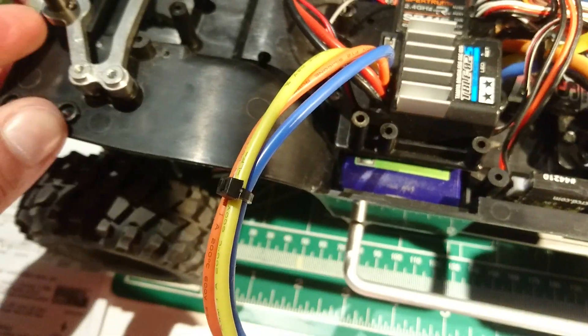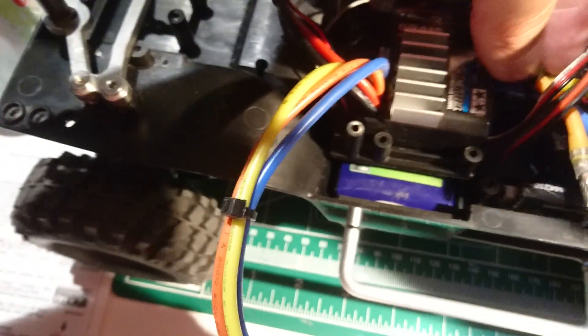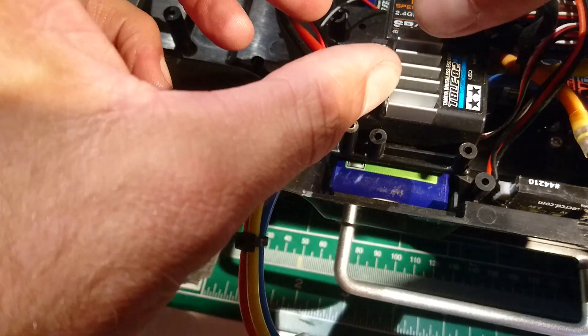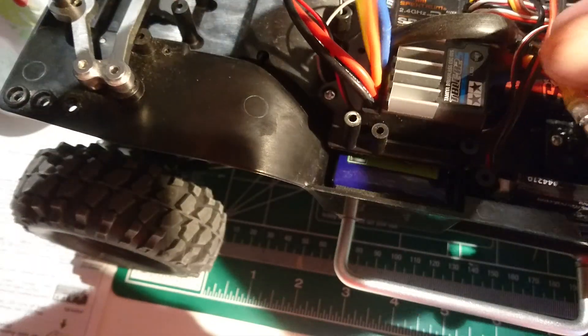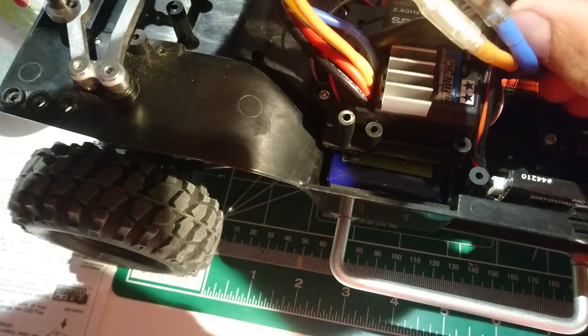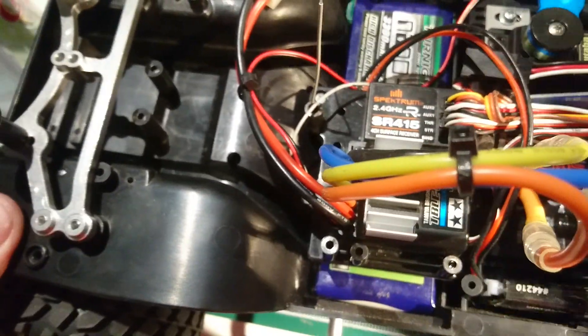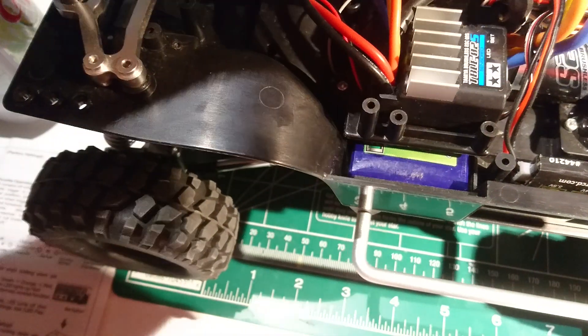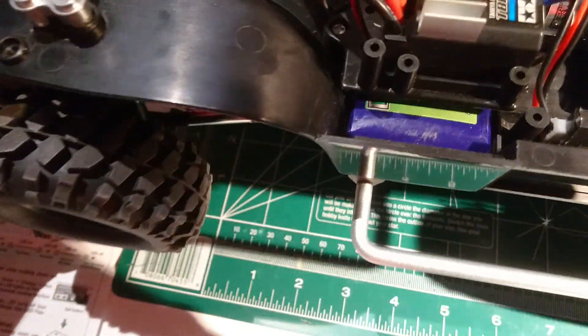Except now I don't have a motor hooked up, so I'll turn it off. I'll go ahead and plug my sensor wire back in — which will probably take me a second. Sensor motor's plugged back in. I'm going to hook up the brushless wires. So now I have the three brushless wires and the sensor wire hooked up. Turn the kit back on — I'm in brushless mode. Now my brushless motor and the kit are running.